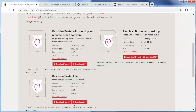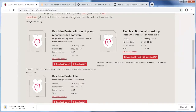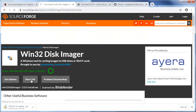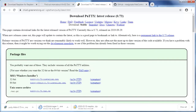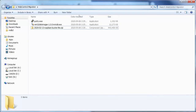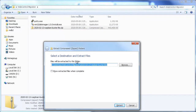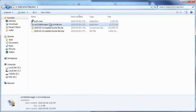We're going to start by setting up the Raspberry Pi. I've chosen to use the Raspbian Buster Lite operating system, so we're going to download that. We are also going to download Win32 Disk Imager. I'm also going to download PuTTY, which is an SSH and Telnet client that allows me to control my Raspberry Pi using another machine. I could control this with a monitor and a keyboard, but I don't have an HDMI monitor, so we're going to use PuTTY instead. And now we can unzip Raspbian and install Win32 Disk Imager.